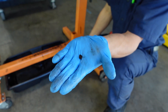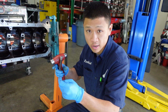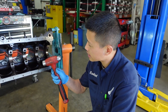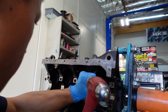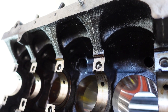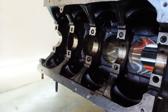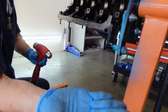That whole piece is just casting flash garbage. Imagine this engine block as the engine runs and is revved — it twists, moves, expands, contracts with heat. Imagine this could fall off and end up in your engine. That's exactly why we're trying to get all this stuff out. Just roughly hitting it — you can see it already made a huge difference. I would recommend doing this before you send it to the machine shop. We're actually going oversized on the bores, but in case you're not doing any machine work, I'd actually clean and tape off all the bores so this stuff doesn't end up messing up the cylinder walls.